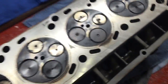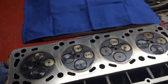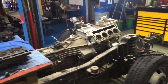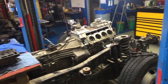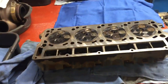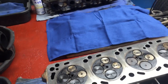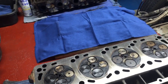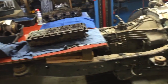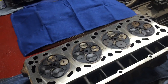So from the top, I don't know what to say, man. But yeah, that is why we have the entire machine shop back in the back, because I'm gonna go ahead and pull these heads apart, and I'll vac test them first, clean them up, see how well the valve job is. I'm gonna have to recess the valves a little bit because I'm gonna take probably another 1,000th off of it. We'll see what it'll take to clean it up.